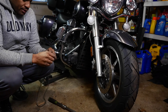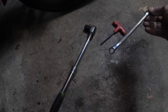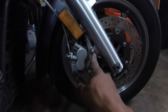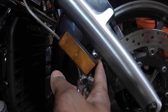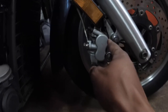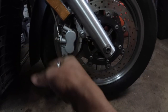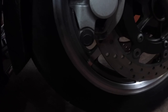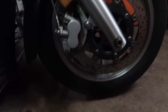There's a few things that you're going to need. As you can see here, we need a 12 millimeter wrench to take off these fork bolts here, which are 12 millimeters — that's this one, and then there is one right behind here. With that, you'll be able to take off the caliper and basically slide that whole thing off. You also need it to take these bolts off here, which is right here, and there's another one right behind here.